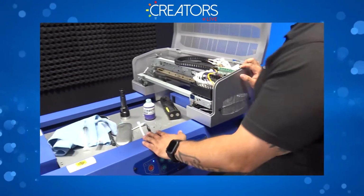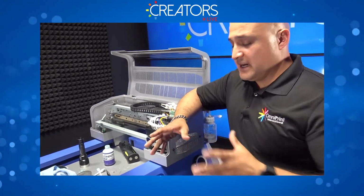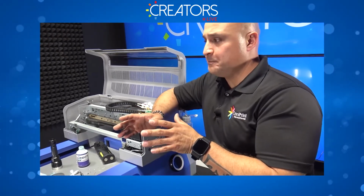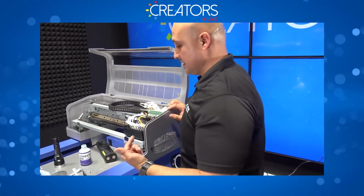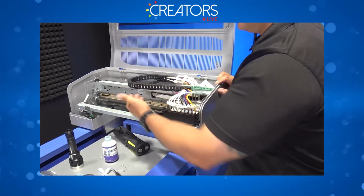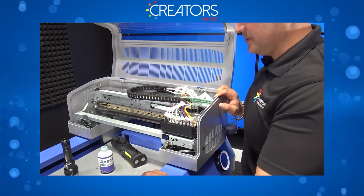Now, depending on your environment, let's say if you have windows at your shop, or if you're printing from home, whatever. If you have a lot of windows and there's a lot of dust, then what I will suggest you do is pretty much the monthly maintenance, turn it into a weekly maintenance. Because if you have a lot of dust in your environment, then your encoder strip and your X belt will be pretty dusty, and that will affect the reading of the carriage moving, because behind this carriage you have a sensor reading the belt and reading the encoder strip.